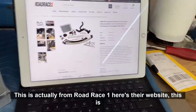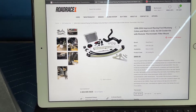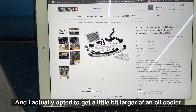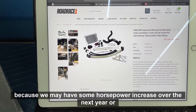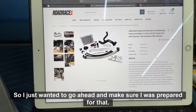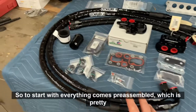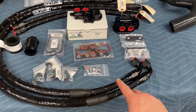It was a good time to upgrade, so here's what I got — this is from Road Race One. Here's their website; this is what the kit looks like. This one is specific to a four-valve mod motor, and I actually opted to get a little bit larger of an oil cooler because we may have some horsepower increase over the next year or two, so I wanted to be prepared for that.